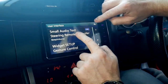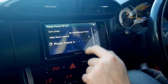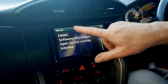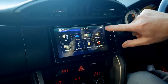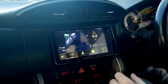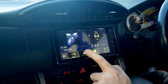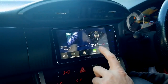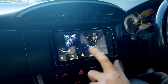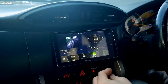This vehicle doesn't have steering wheel controls but we have other videos showing how to set that up. You can set up photo frames through the widget settings and load custom images via USB. That covers virtually all the changes made to this new unit. The main takeaway is wireless Apple CarPlay, but you must have that Vehicle Speed Sense wire hooked up. Android Auto without the VSS wire — you can use Android Auto without it connected, so if you only use Android you don't need to worry about the VSS wire.